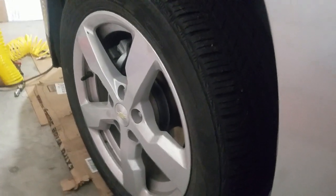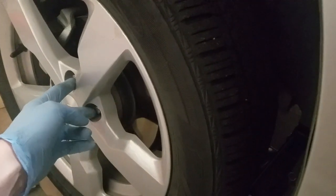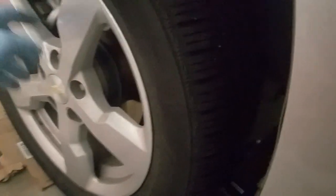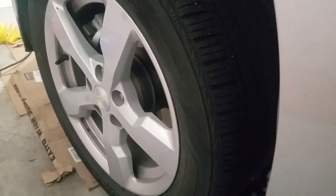When you pull off the wheel, you want it to be just above the ground so it's not free spinning. Right before this, you want to start to loosen the lug nuts while the weight is still on the vehicle — it makes it a lot easier. Now that it's a little loose it'll spin more freely. Our wheel's off and lug nuts are out. Get yourself a magnetic tray — they make life a lot easier so you don't lose everything.